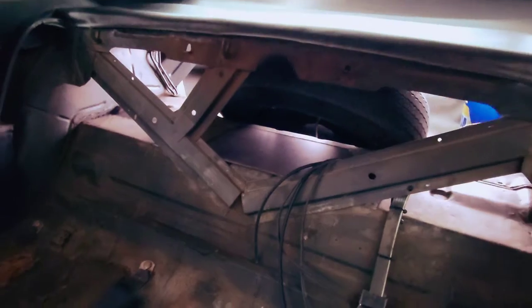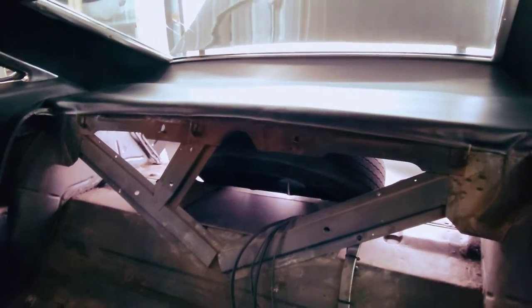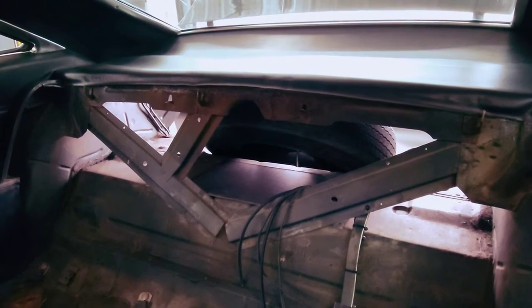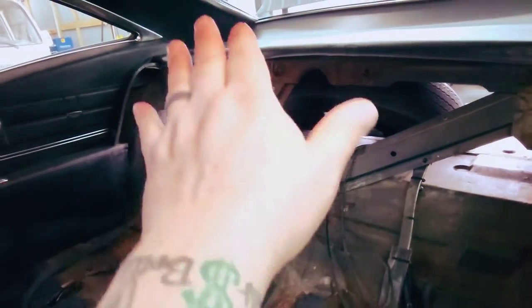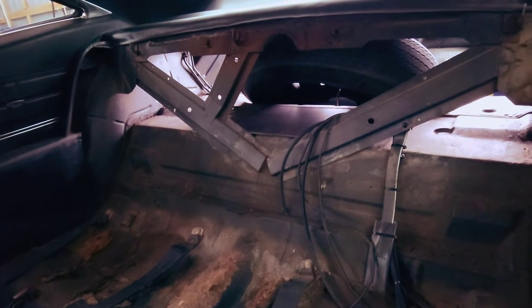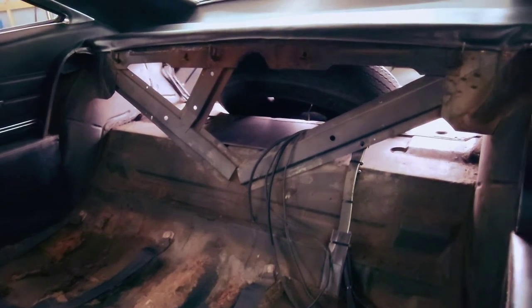The rack will be Velcroed. It's not just regular Velcro like you use in your kitchen. It's that ridiculous Velcro that can hold 100 pounds. There's no way I'm gonna put holes in the body of this vehicle. So after I prep clean that metal, I'll use adhesion promoter and stick it. It'll be fine. You'll be able to pull it up because of the Velcro, but the bottom will never remove from the car unless you want it to.